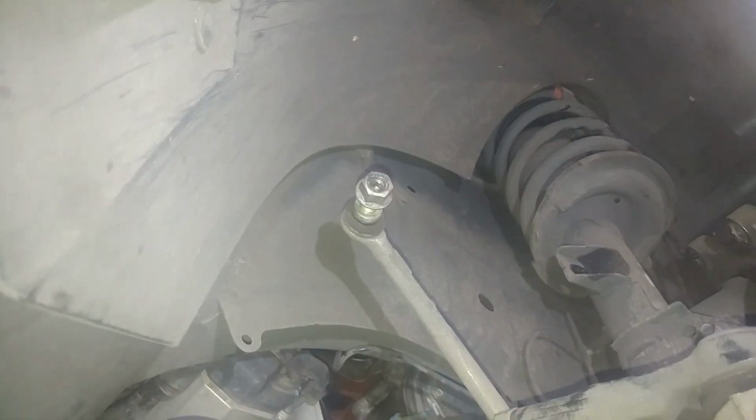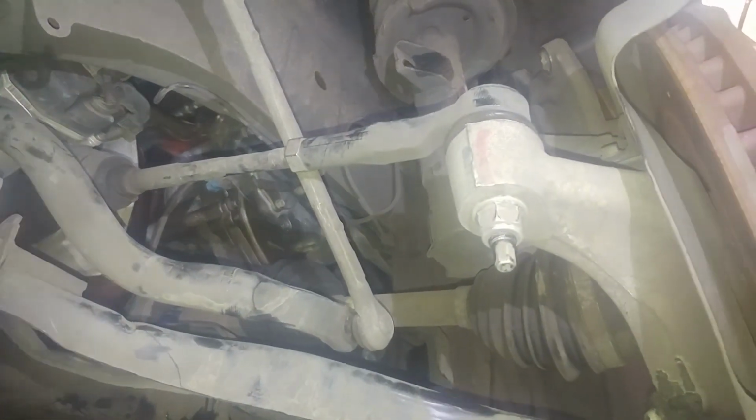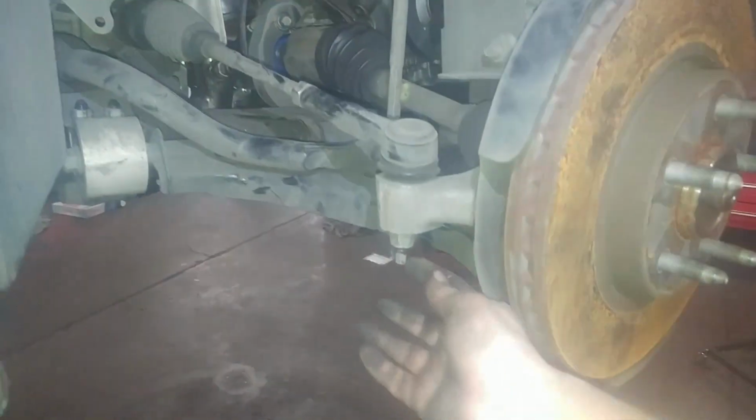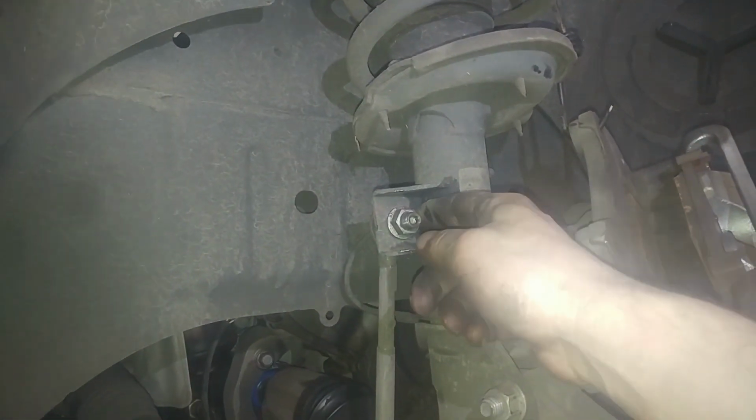And we'll continue to put it together. And this is an 8mm, 5/16, kind of like this. Oh, that's an Allen, that's right. So use an 8mm to hold this and turn this in case everything is turning. So that's how to install that. Like an open end wrench on here, and then maybe an open end wrench or a socket on here if you need to. Tighten that to 44 foot-pounds. This gets tightened to 55 foot-pounds.